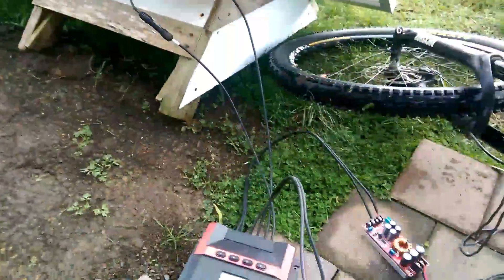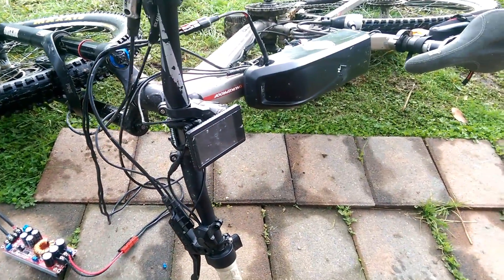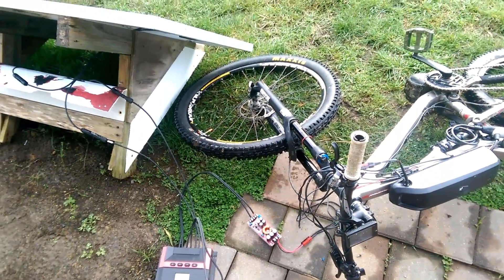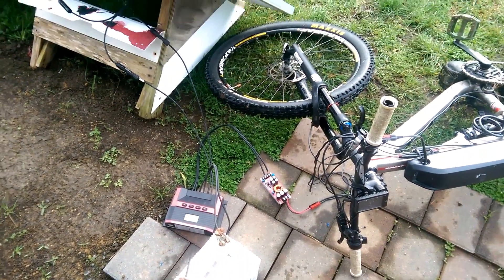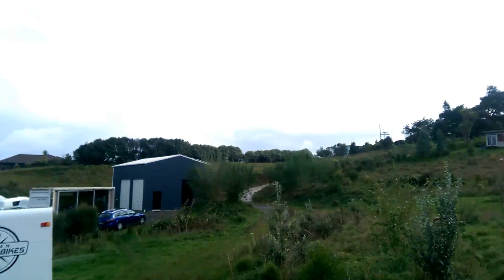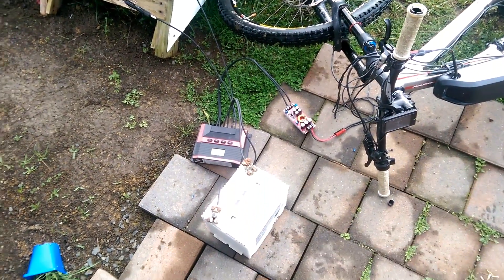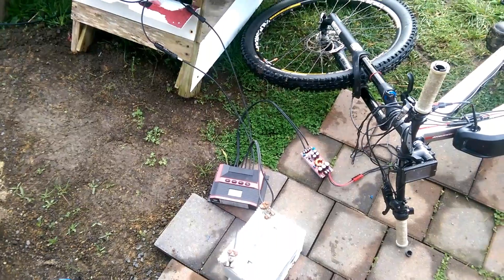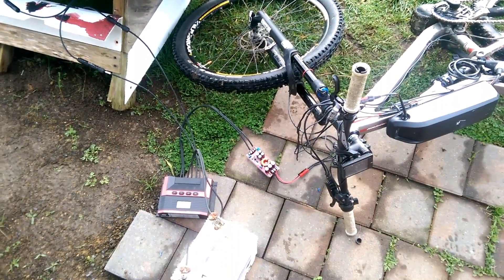Have two roll-up panels, one small box probably the same size as that, and that would be all you need beyond having your bike. It's currently charging the battery at about three and a half amps. When there's more sun than can go straight into the battery, it's putting it into the car battery. And when there's less sun — as per now because it's a bit grey and misty — it can draw down from the car battery. So maybe some capacity here to smooth out the peaks and troughs, or maybe just accept that we take directly into the bike battery whatever is available. Since the bike battery is our storage, it's silly to have too many lots of storage.